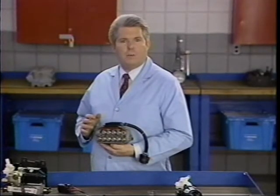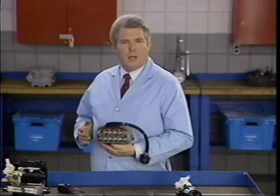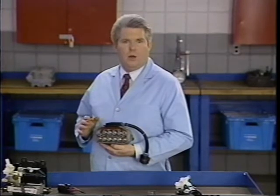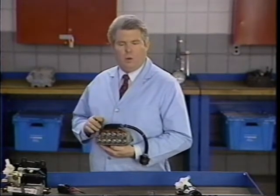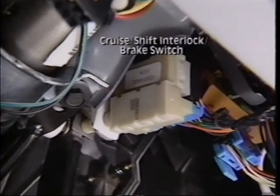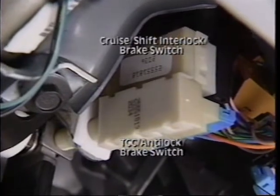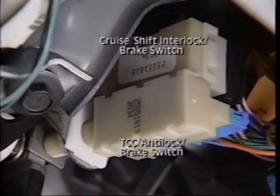When intermittent problems are suspected with either the relays or PMV, it is very important to check the vehicle when it is both hot and cold. Code 74 can also be caused by a failed or incorrectly adjusted brake switch. Check the service manual for proper adjustment procedures.